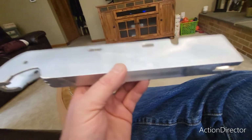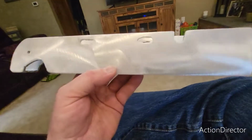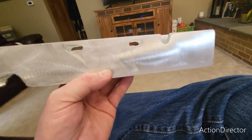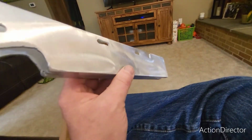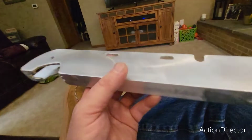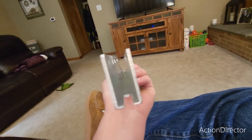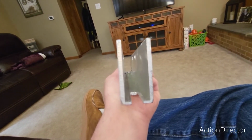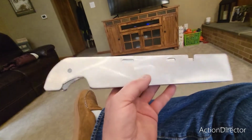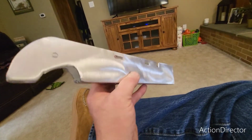The nice thing with this being 2 inches deep is this should actually buffer any trolling motor white noise, if you will, rather than if the transducer was actually clamped right up to it. So with that buffer and this piece of aluminum here separating the two, it'll be mounted like this. So that's a huge air gap. Not to mention it'll be flooded with water. So white noise shouldn't happen. Shouldn't have any interference from that respect.